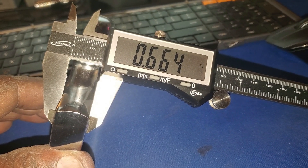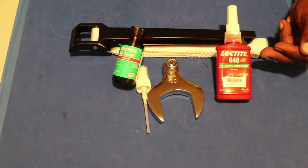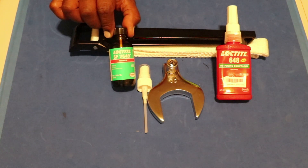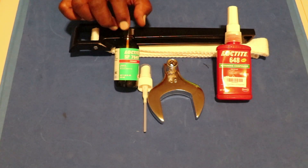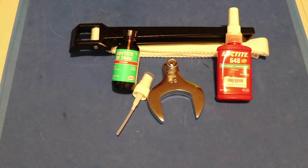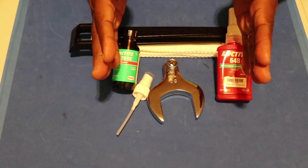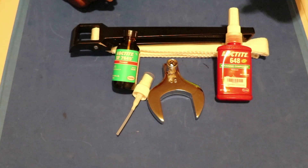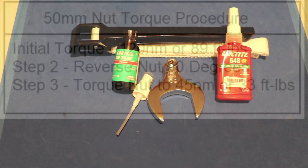The other materials are the actual Loctite adhesive we'll seal it with, plus the Loctite SF7649 primer. After cleaning the splines, I'll apply the primer to prep the surface for better reception of Loctite 648. This is the actual adhesive that works anaerobically — you want to put enough so that the material self-seals the ends of the splines, closing off the center from oxygen, because this adhesive cures best without the presence of oxygen.